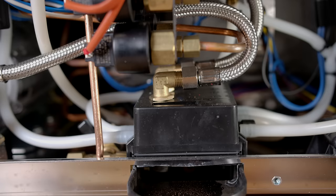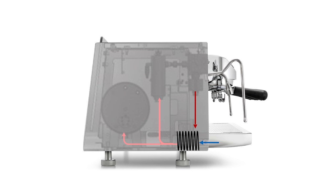We could go further still, and this one is so ridiculous but I completely love it. Inside the drain box where all your hot water waste goes, there's a heat exchanger. It pulls the heat out of your drain box and uses it to preheat your brew water. There is no thermal waste, or as little as possible. It turns out you can get up to 8% efficiency by doing it this way. It started as 'this won't work, but we should try it — wouldn't it be fun?' and turned out to be really quite valuable. Against what would be a popular choice, it uses about a third less energy to make the same number of drinks.